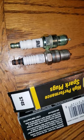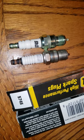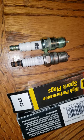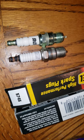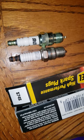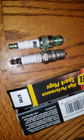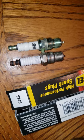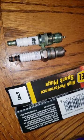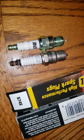The Accel plugs are the 574s. The heat range is similar to NGK7 on both of them. The Autolite is a three heat range on their specs but it's more like an NGK7, and the Accel is like a four heat range, which is also similar to NGK7. These are good for a 350 small block Chevy.